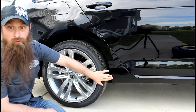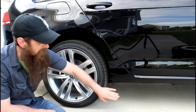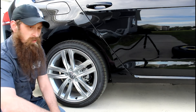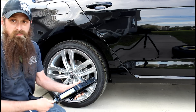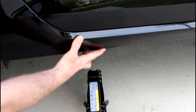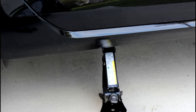Now it's time to lift the car. About 12 inches in front of the back of the quarter panel here, there's a small divot. It was really hard to get a picture of, so you're just going to have to kind of eyeball it. If you run your hand along the rocker, you can actually feel it — that's the spot that we want to install the screw jack in. The car is quite a bit taller than the jack, so by hand we're going to twist this jack up just a little bit. Then we get the other piece to the jack, which is the screw tool. You'll see the little divot is actually right here, and about three inches behind there you'll find the pinch weld of the car. Now we've got the jack secured here.